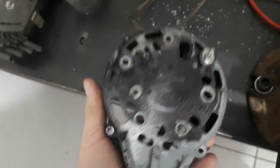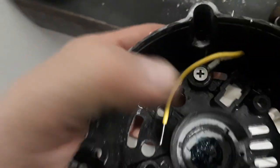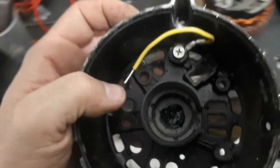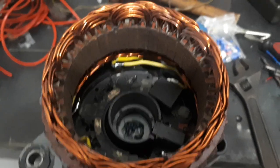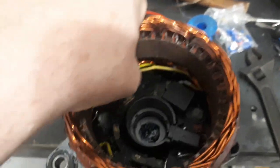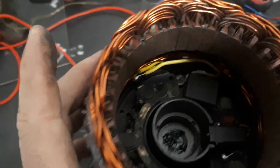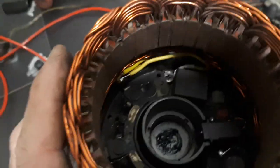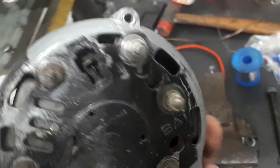Here's how it looks externally — we have the bushing, and the bushing has a nice shape for fitting the rubber cover that goes in here and protects the terminal. On the inside you can see a small screw with an internal insulator and a piece of rigid wire that I'm going to solder into the field on the windings. Looking from the inside once assembled, the wire is soldered here on this terminal — it can be on any of the winding terminals in phase. It's a three-phase alternator and I've used solid copper wire so it stays firm and won't fly into the rotating part. On the outside the terminal looks almost like it's been there from factory.